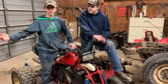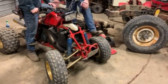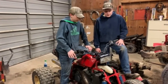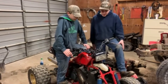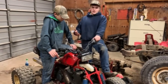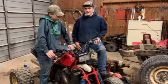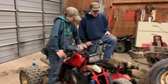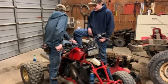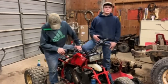We're probably still going to have to do general maintenance and wear items. The front tires are gone — it needs front tires. We'll go through and make sure the quad has what it needs. Mechanically, the quad is very solid, but there are a few things that need some care and love. For example, the kill switch doesn't work — that's kind of important to have. As far as gearing goes, we'll probably leave it the same just to run the trails. We'll probably put a new chain on it because this one has a little corrosion. When this is done, it should be pretty cool.